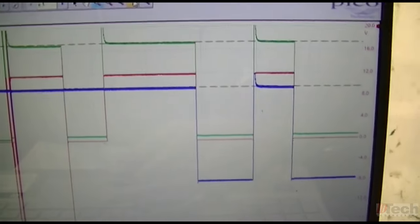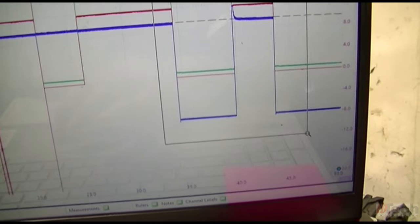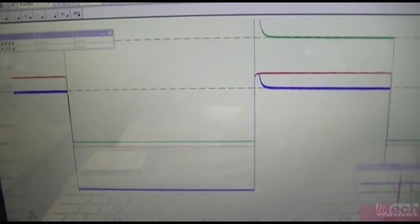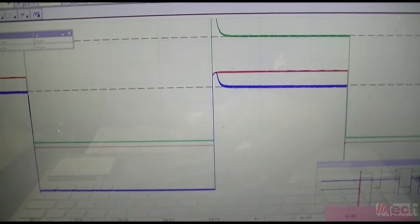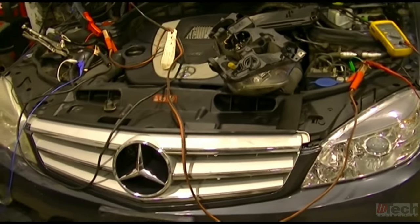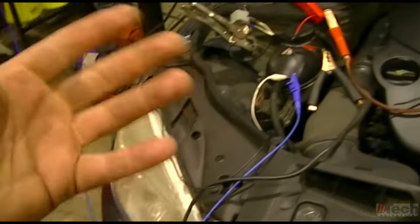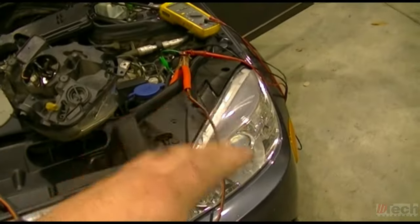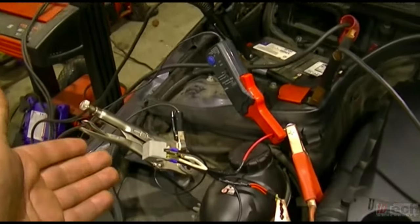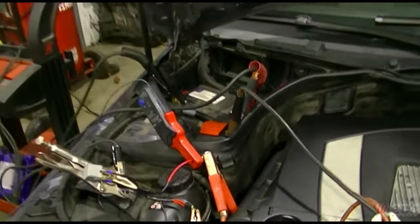And again, at this point, it was all controlled by the switch and not by me connecting and disconnecting the wire, so everything still working in that normal operating range. So I would say, thinking based off of that information that captured of monitoring just the one lamp, what it draws, where that level went when we added the second one being fed, but only via a relay. So the amperage that we take for the relay feed is very, very, very minimal.